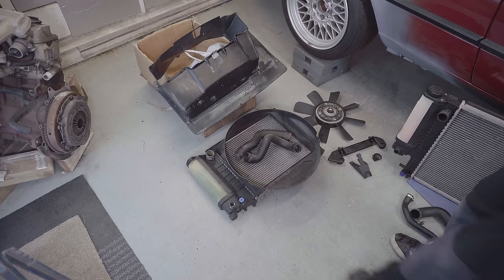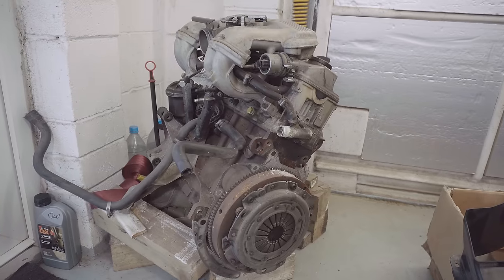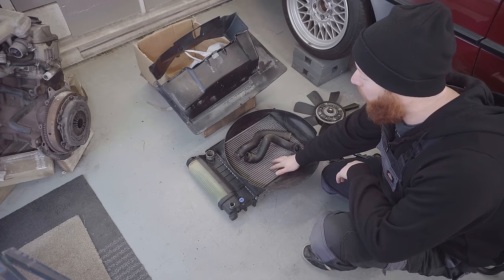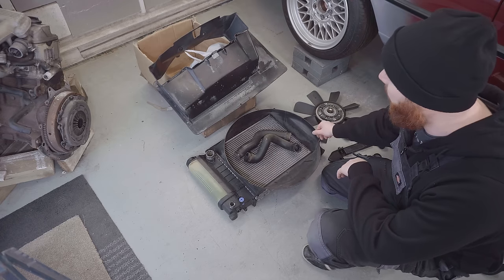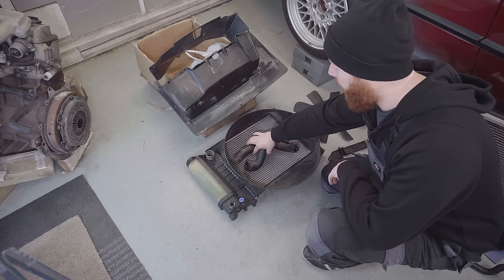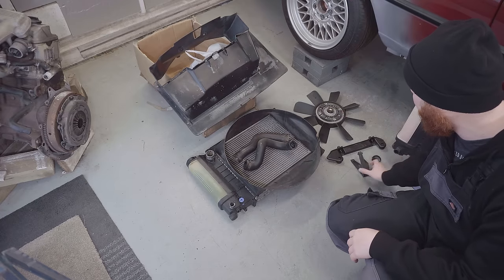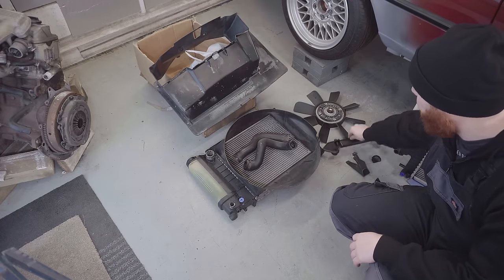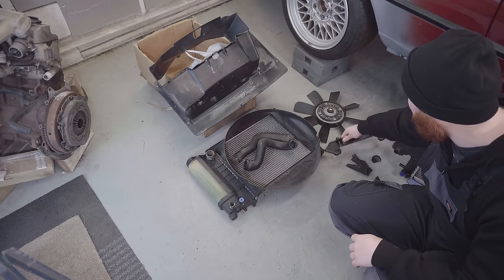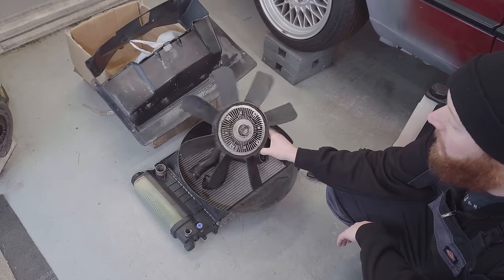With the E30 being a 316i M40 powered car, the M40 over there, originally, this is the cooling system it came with. So this is a small E30 radiator, rear shroud, front shroud to channel the air, two large hoses for either side of the thermostat on the front of the engine. The bracketry that secures it sits on these little pucks, and there's this top crossbar thing which clamps it down from the top on the top of the front core support,